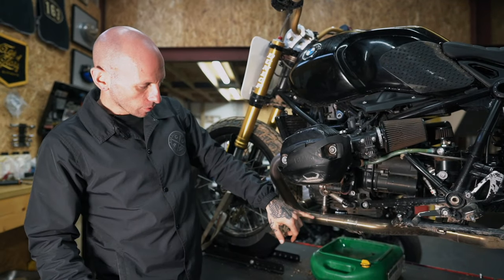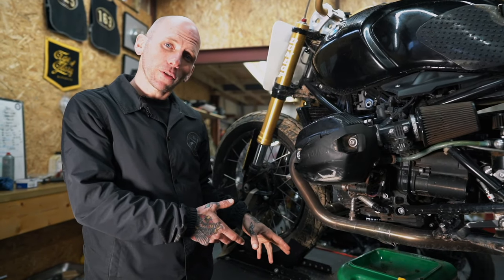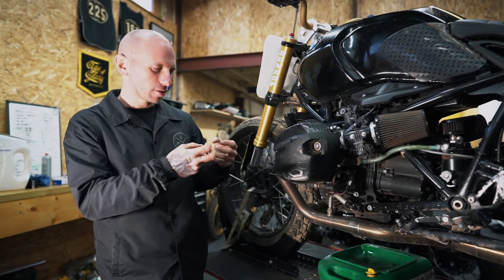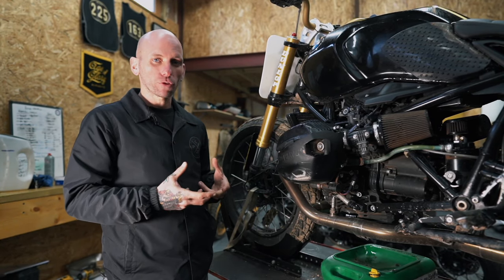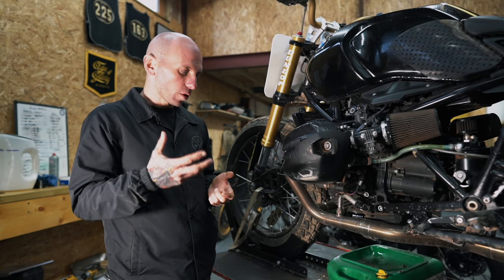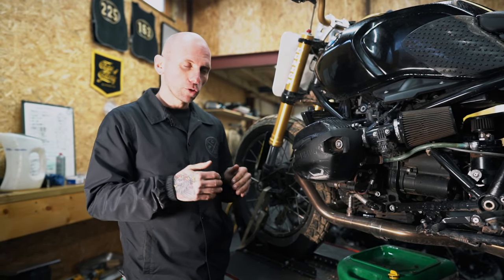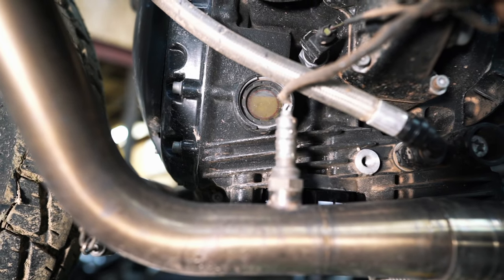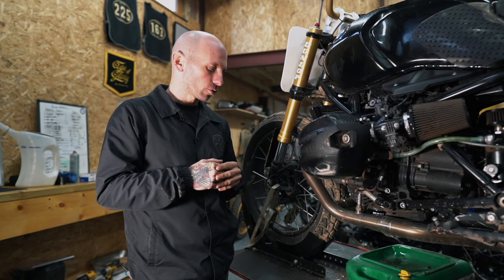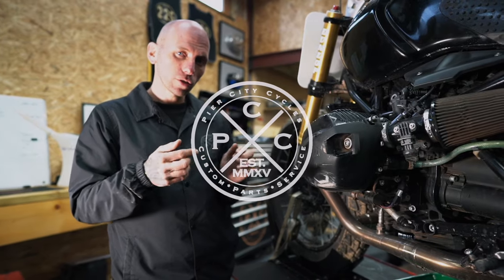What you might find is a little bit of smoke — that's just some waste oil from when we dropped the filter burning off, sometimes dripping on the exhaust. You might also find a few oil drips underneath the bike from waste oil around the filter or sump plug area as it warms up. Use a little bit of brake cleaner to clean everything off and make sure there are no serious leaks. Once the bike's run up to 80–85 degrees, leave it for two to three minutes, and the sight window should read somewhere between half and full. The sight glass covers around 250ml top to bottom, so you can safely add about 100ml at a time to reach the correct operating level. Dispose of your waste oil correctly, check all your torques, and pop any questions in the comments below.